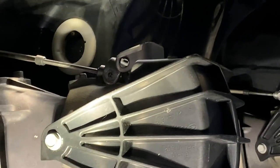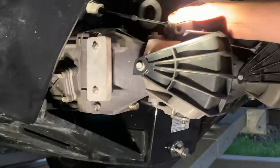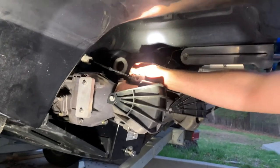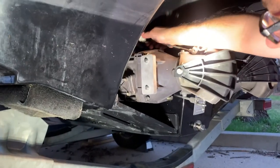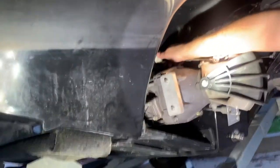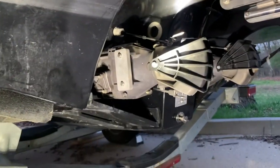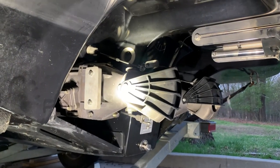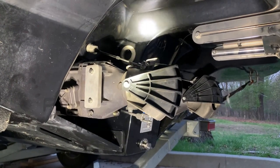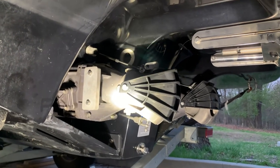I appreciate you guys watching the video. Just to let you know, the tools I used were a 10 millimeter on each side of these nuts. This part I did by hand, but if you had a wrench it would be 1 and 1/16 on each side. I used a Phillips head at the top, a flat head, and a little tiny mini flat head just to pop those locking rings off. Otherwise, you don't need much for tools. So we're all done — hopefully this helps you guys. It would be nice if you could like and subscribe. Thank you.